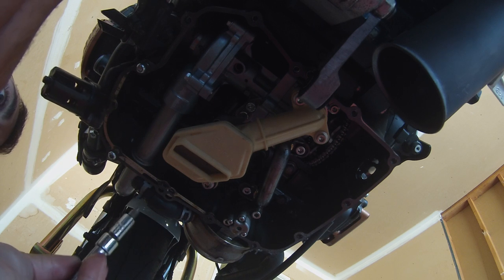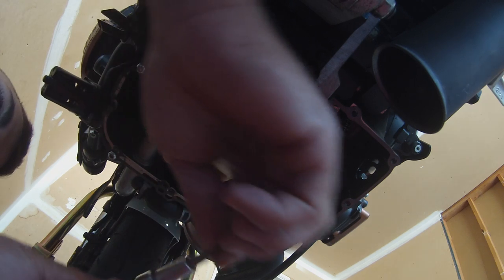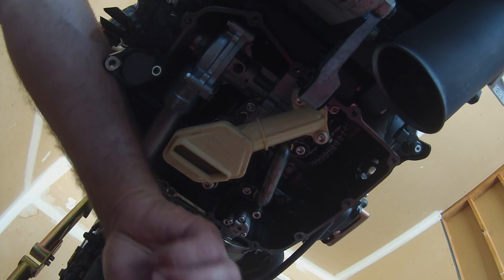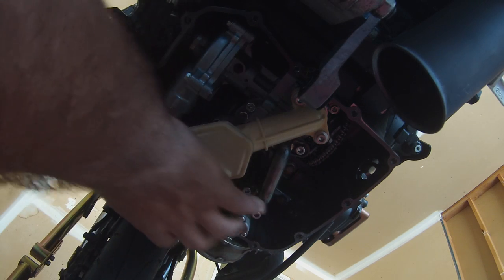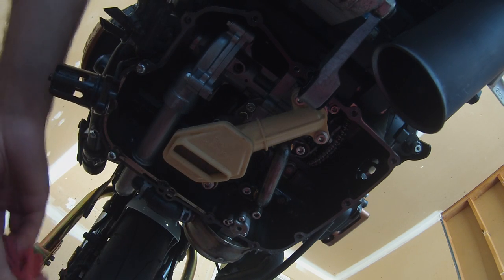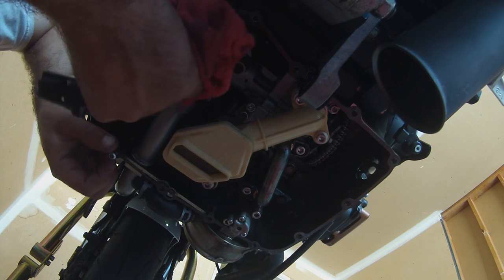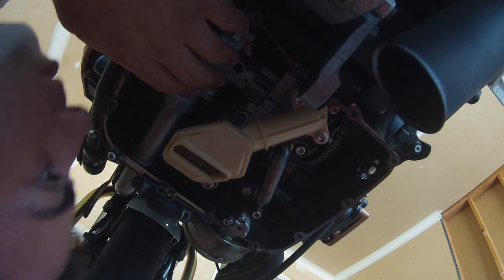You're gonna need a Torx. No, T30. The T30 Torx you'll need for all the bolts in this oil pan. Every one of them, Torxes. Left a couple screws in here just to hold this filter up, our gasket, and we are ready to put this oil pan on. Take another double check on everything.